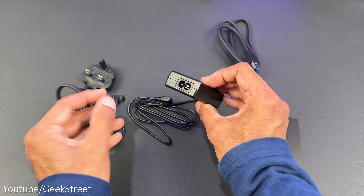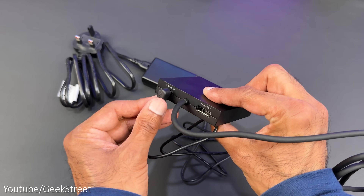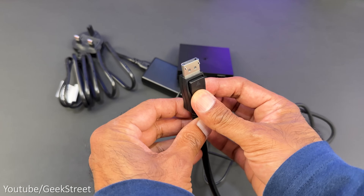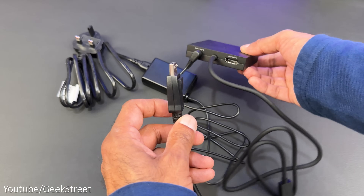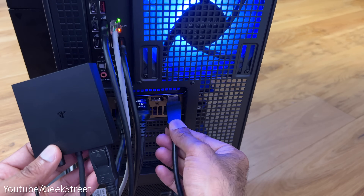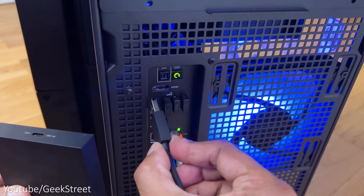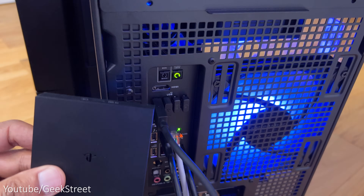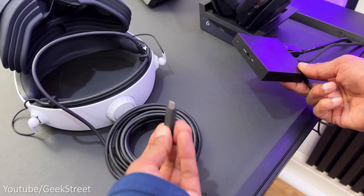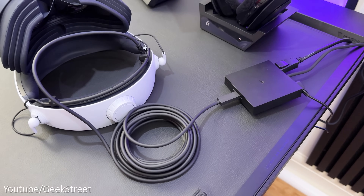Connecting up the adapter is pretty simple. First connect the power cable into the power adapter and then plug the other end into the DC port on the PC adapter. Then plug in a DisplayPort 1.4 cable from your PC into the back of the adapter — it's a bit of a shame that that's not provided in the packaging. Next plug in the USB-A connector from the PC adapter into your PC. Don't use an extension cable or a hub as this could cause problems, and then on the front of the adapter connect the USB-C from your PSVR 2 into the PC adapter, and that's it.